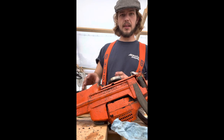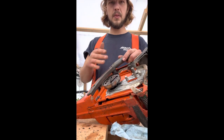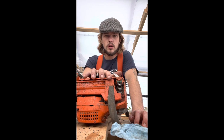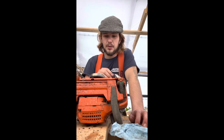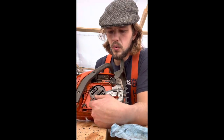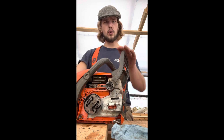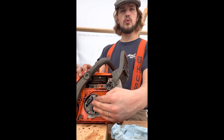That's pretty much it for getting in past the metal piece and all the hard stuff. From here on out you know how to use a chainsaw and you should be able to do the rest. Because we don't have specialty tools, there's no way to tighten the clutch any further with a tool at this stage. All you need to do is put your bar and chain back on, put it all together tight, start her up, give her a shot of fuel and then lock her — when she locks she'll jam and that'll cause the clutch to tighten up fully.